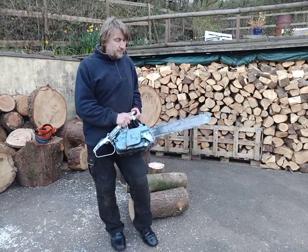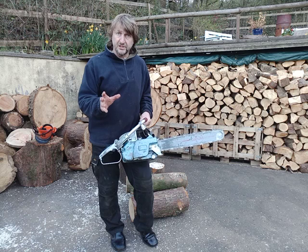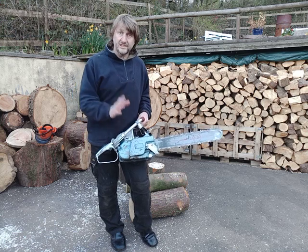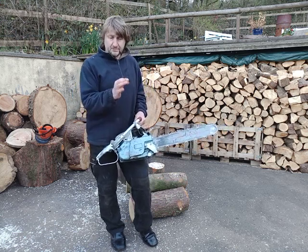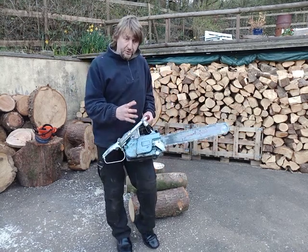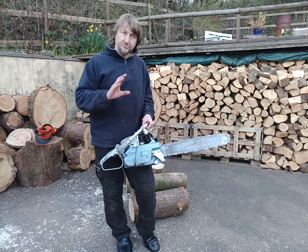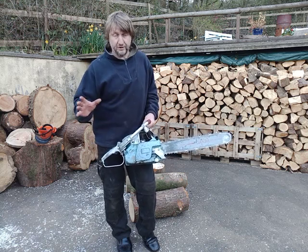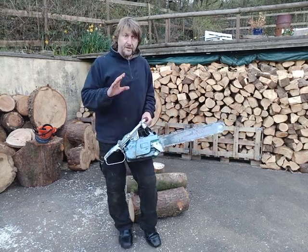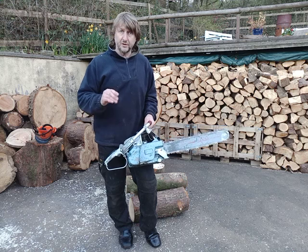And so I experimented with a couple of my engines with the acetate type material, which you can get for this Tillotson carb, and I also bought a couple of high quality Teflon pumps, exactly the same shape as the rubber pump you would get for the carb, but in Teflon. It's resilient to all the different gasolines, and even nitromethane is fantastic, but its pumping capacity is really high, and so it outperforms lots of the engines I've previously tried them in.